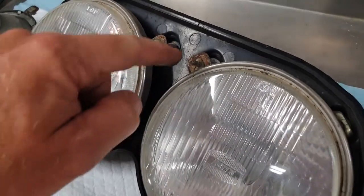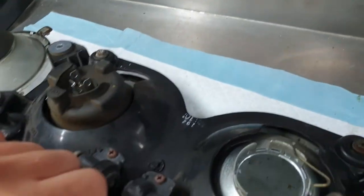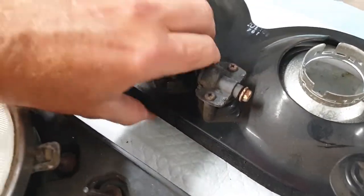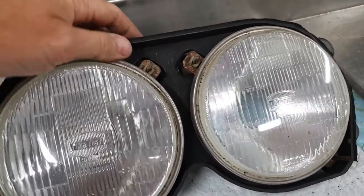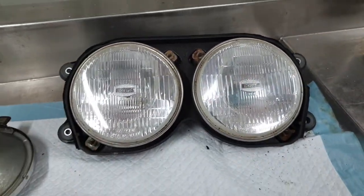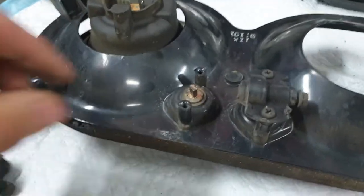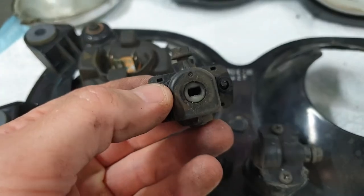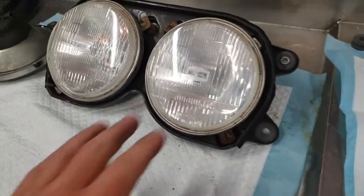To pull the lights apart I need to back these adjusters off - they go through this geared assembly here so you can adjust it from outside the bike a bit easier. They're all seized up, so what I ended up doing was unbolting this assembly on the one I'm going to use and spraying some CRC in to free it all up. I was able to pull it apart. I can see why the light rattles around on this one - this part here is all worn. I'll strip the set down with the cracked housing and grab the pieces I need. I was able to just use a pair of pliers to free it up without stressing the plastic gears.